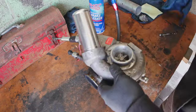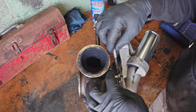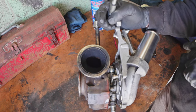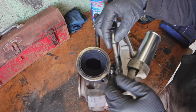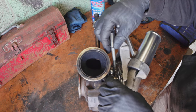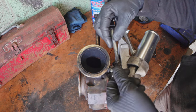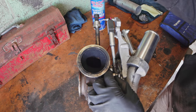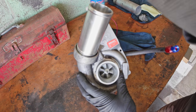I'm going to put the rest of this turbo back together. Right now I'm going to set our minimum vane position. This is the actuator that's going to move it — right here is fully open and right there is fully closed. I have a few turns in: one, two, three, four — so we're pretty much fully closed. I don't ever want the turbo to be fully closed because that's too much; the engine probably wouldn't run well. So we want it about there — I'll turn this in a few: one, two, three. That's almost all the way in, definitely a little bit open. I'm going to check that this orientation of the cold side is appropriate for the hot side in the car, and always do one final check.